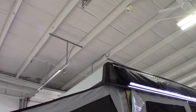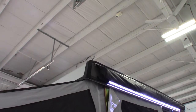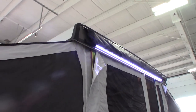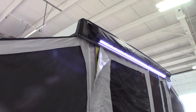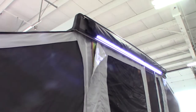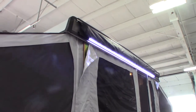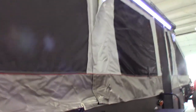You want to remember to inspect the seals on the trailer — look at all four corner caps and the sealant around the roof vent. Do this every 90 days or so, give it a good look over to make sure there's no cracking or separation. If you do see it, take care of it immediately. Don't use caulk from the hardware store — you have to use the proper stuff, which in this case is called Clear Proflex. You get it from an RV place; it's only about $10 for a caulk tube. Any place you see caulk from the factory, you inspect. It's very important when you own any trailer.